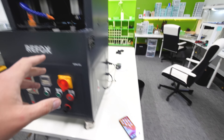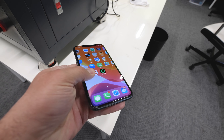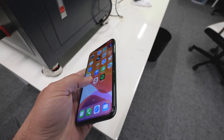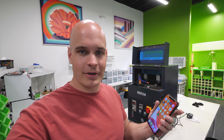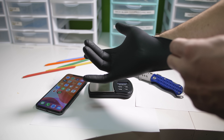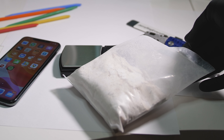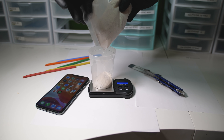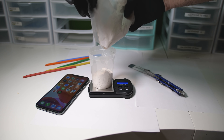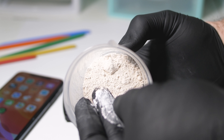The whole concept is that we are going to remove a microscopic layer of glass off the surface of this display using science. We need something harder than a level 6 on Mohs scale of hardness. In our particular case, we're going to use a super fine powder called cerium oxide. Each of these tiny pulverized fragments of dust are harder than a level 6 on Mohs scale of hardness. We'll measure it out and add it to distilled water to make that magic sauce that removes scratches from smartphones.